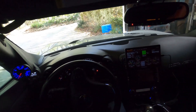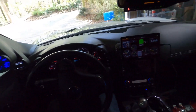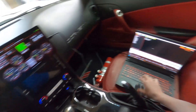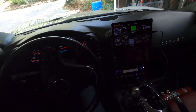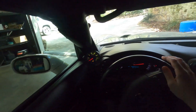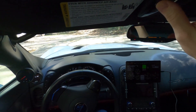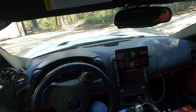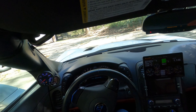As you can see, once it fires, it fires right up. The battery was a little low so it starts kind of slow — you'll notice it takes a few rotations to actually fire up. You can change that; I have it set on purpose based on how it syncs. You can have it start up without cam sync, just based on wasted spark. I had that on originally and it fires up instantly. I turned it back off so that it rotates the engine a few times before it gets that sync and fires up. I did that for my application because I don't drive the car as often as I should and I like to get a little oil flowing before it fires the engine up.